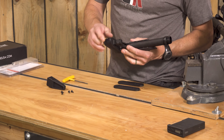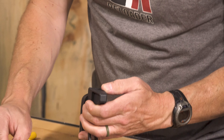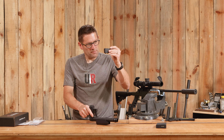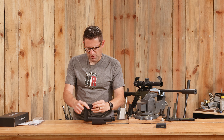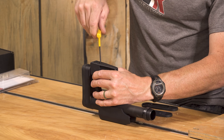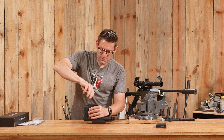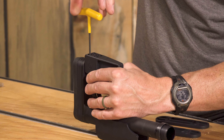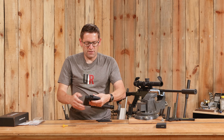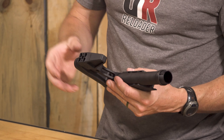Got everything out of the packaging. There are four small holes on the bottom for the bag rider. I'm going to get these pre-staged using an eighth-inch Allen key. I threaded all the screws through and got them pre-aligned, then tightened each one individually, running each screw down until I could barely feel torque, then giving them all a final torque — that helps things line up better. Bag rider's on. That looks pretty cool. It's easy to remove if we're hunting and don't want it catching on tree branches.